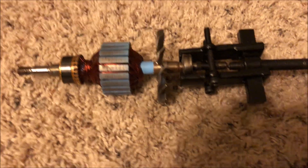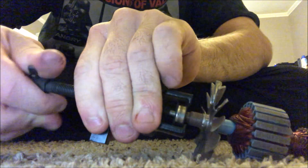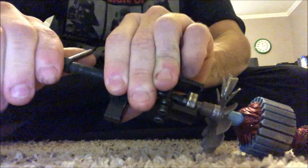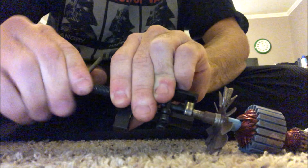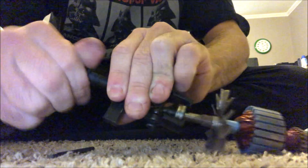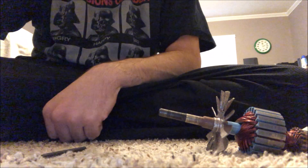To get the one off the motor shaft you're going to have to take a bearing puller tool, get it leveraged just right. To get this one off you just want to hold it in place and turn it clockwise to pull it out. Once you've got it pulled off, there it is — your old bearing is off the shaft. This one is nasty; I don't even know if it's worth rebuilding.